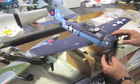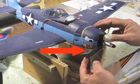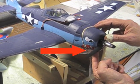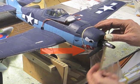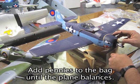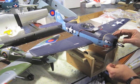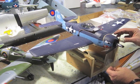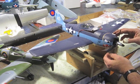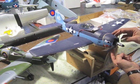Here's the other trick: we hang a plastic bag from the spot where we're actually going to put our weights. I know I'm going to put them right there on the inside of the cowl, so we hang the bag from there and then start adding pennies to the bag. One — not enough. Two — not enough. Three — not enough. Four — look at that! So this means I need to add four pennies onto the inside of the cowl right at that location.